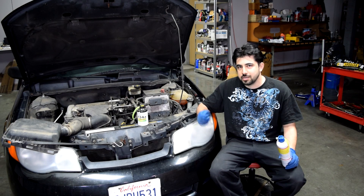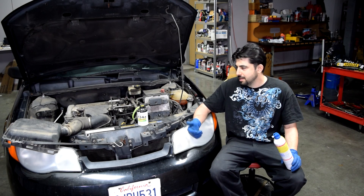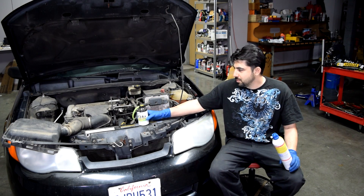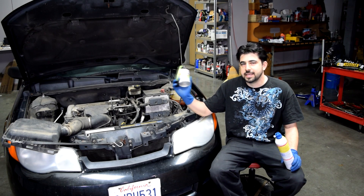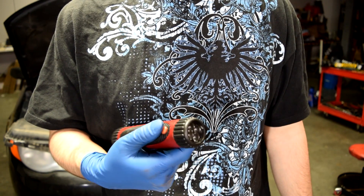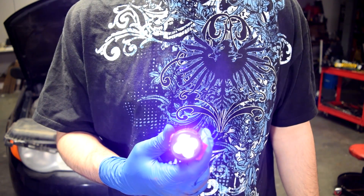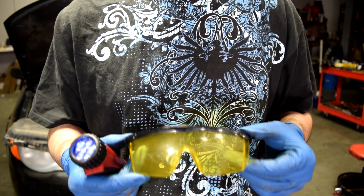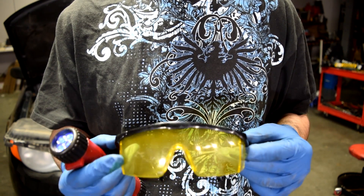If tomorrow you turn your AC on and you're not getting cold air, or it's not as cold as when you added the refrigerant, that's probably because you have a leak in your system — which is the reason why we added the refrigerant with UV dye. This is going to tell you where the leak is, and if you choose to, you can fix it yourself. In order to see the UV dye that's leaking out, you're going to need one of these UV lights. It would also help to get one of these glasses — they enhance the UV light and you'll be able to see it easier, though they're not necessary.